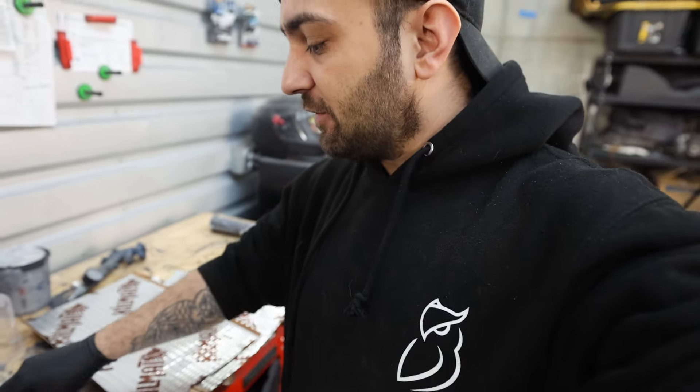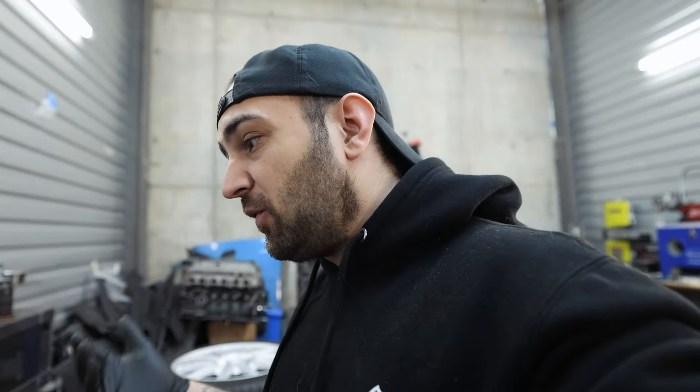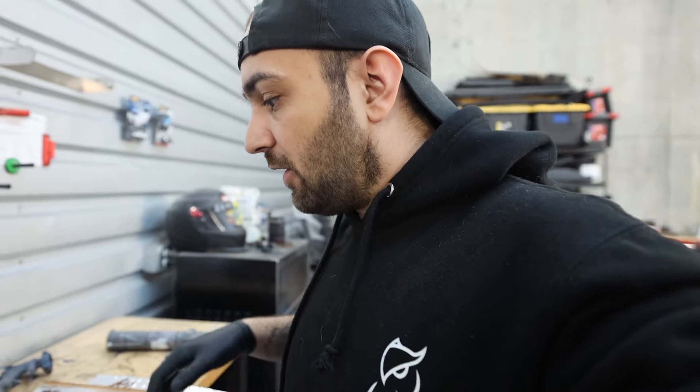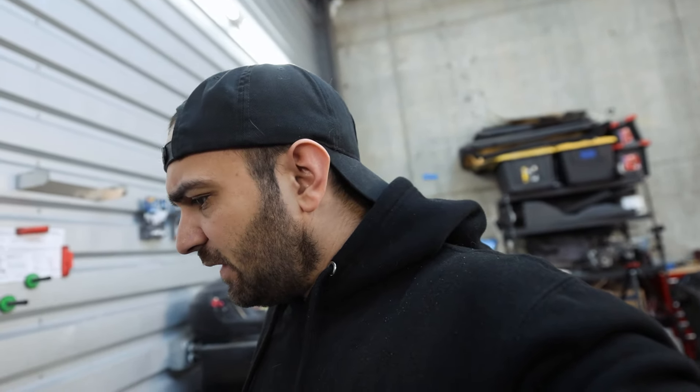I've been racking my brain with things to do on the Subaru while we wait for everything, and we can go ahead and knock out sound deadening. So these are all of the body plugs — I just went through, cleaned them all, got a new tube of seam sealer, and we need to seam seal all of those body plugs into the chassis. I've heard they're there for if the car floods so you can drain the water, or that when they paint the cars they dip them and those are the drainage holes. Regardless, we need to seal it up before we put in our sound deadening. I am using Kill Mat — it's exactly what I used in the RX-7. You just use these little rollers, roll it on, and it sticks on there pretty well. This is a car I want to do some long-term driving with, and I would like to not get the absolute poop beat out of me by vibrations and sounds, and Kill Mat works pretty well — and I still have some left over.